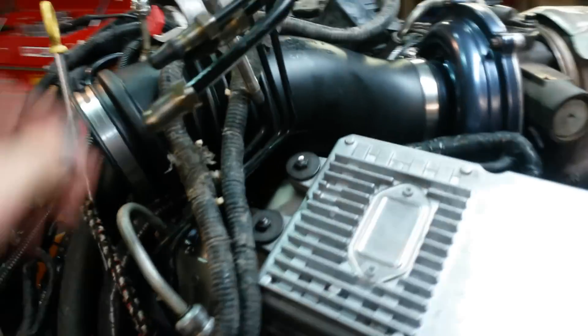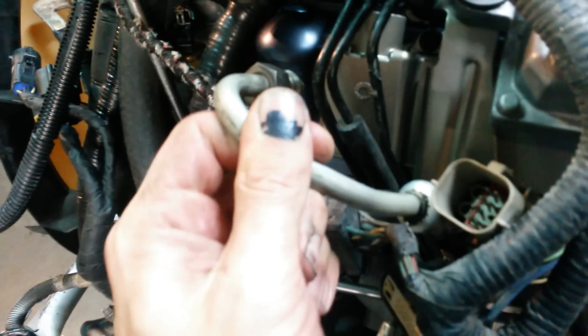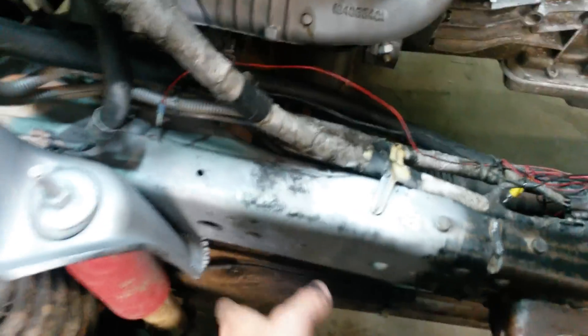Cab lowering checklist starting with the driver side. You want your transmission wiring harness, your trailer brake and control harness relay, and your lighting harness. You want both of those clusters up and with the engine. You want your power steering boost line up and with the engine. Any accessory wires or accessory power lines, you want to make sure they're not over the frame.